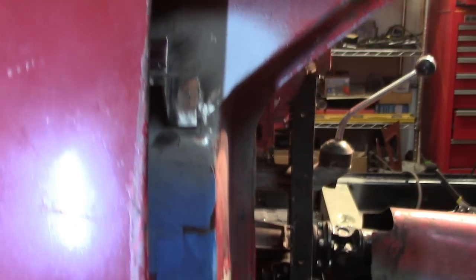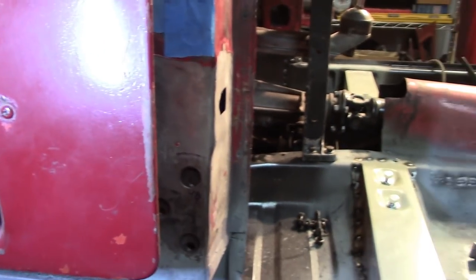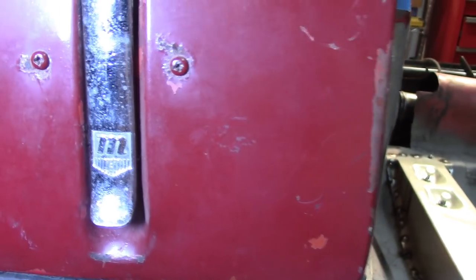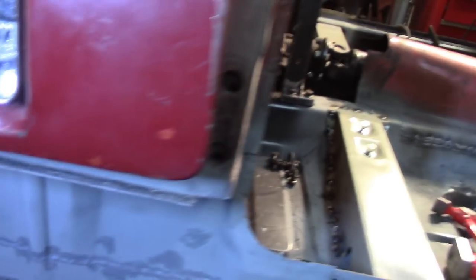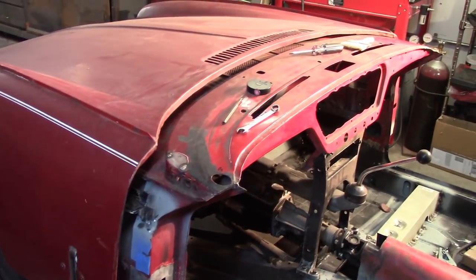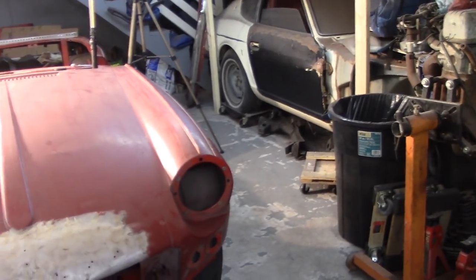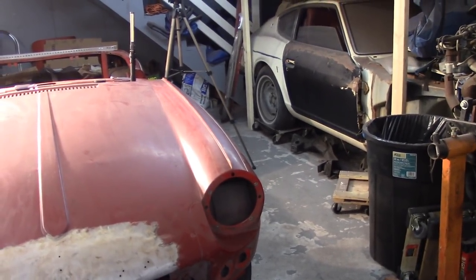The door was rubbing in over here — you can see right on the edge of the bonnet where the paint's all messed up, and there's even some metal that bends a little bit there. The door hinge is not aligned, which might just be something I can tighten. I thought maybe the broken check strap on the door was causing that, but maybe the whole bonnet is twisted a bit. So that's what I'll focus on next time — study the workshop manual and hopefully it's just a matter of twisting one side in and pulling the other out.